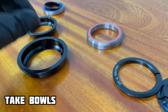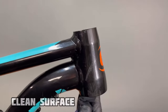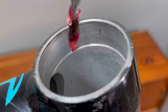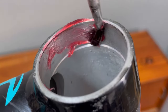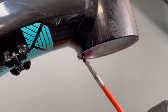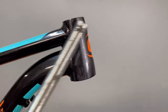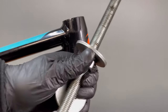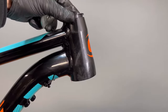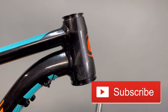Okay, from the kit take two cups, upper and lower. Clean the surface inside and use grease to press the cups inside the frame. Use a headset press. You can find a video on my channel on how to make this tool. Put the cup inside the frame and use the tool to press it.